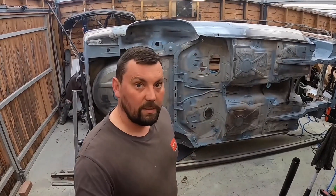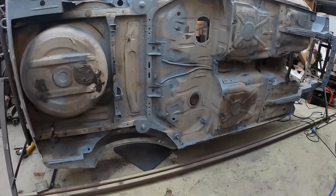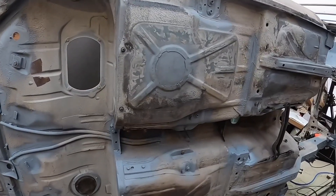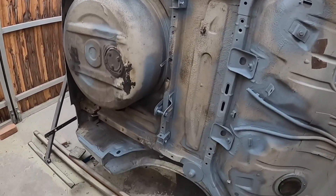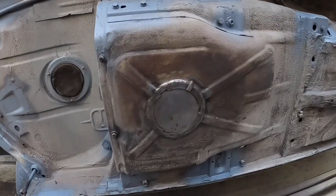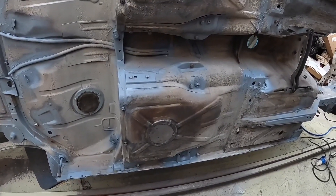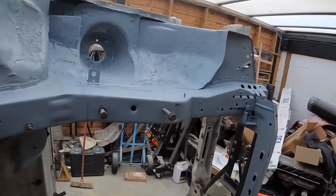So here we are, a lot of steam cleaning later. We'll show you the underside of the car now. We've been doing quite a bit of other work to it other than just steam cleaning - I've been trying to get rid of all the rust using a wire wheel and the shot blaster. That's why you can see the gray patches, just protecting what we've done. There are a couple of patches that still need doing where the wax oil is still on it - I'll probably hit that with a wire wheel just to get the main bit of the wax oil off. She's looking a lot nicer.